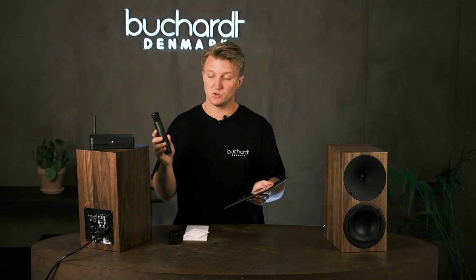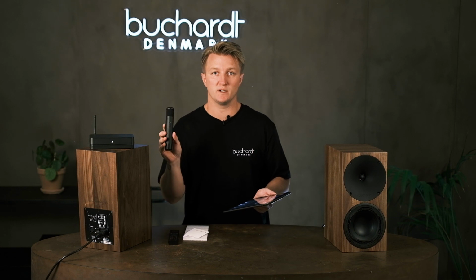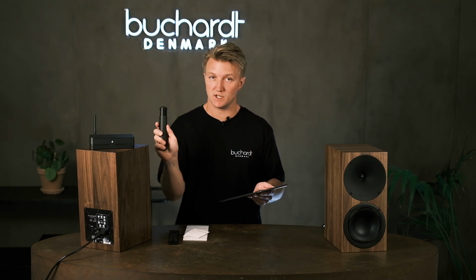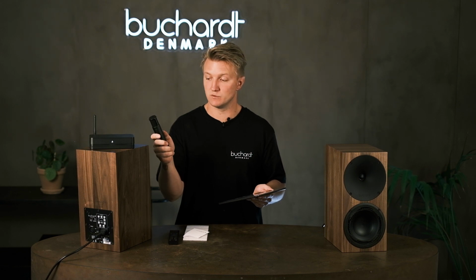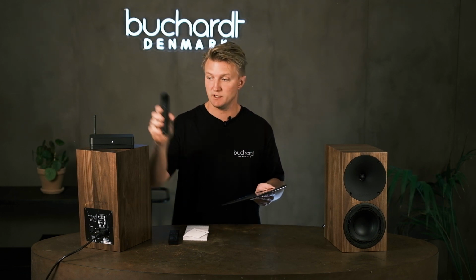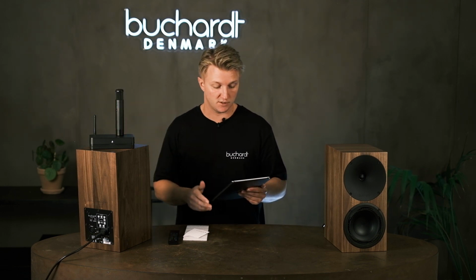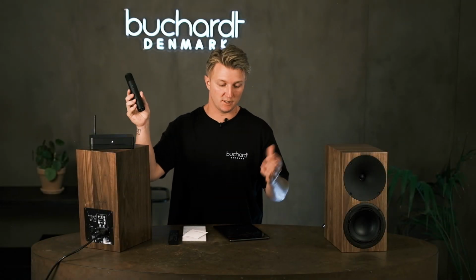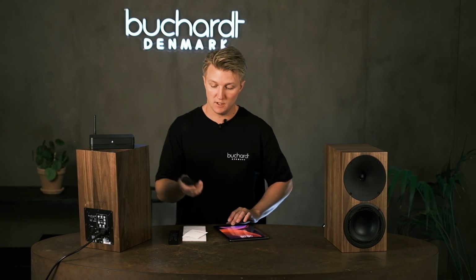So the first thing we need to do when we have connected it to the Wi-Fi is to perform an update. It's pretty easy. You just tap 4 times on the power button. 1, 2, 3, 4. And it will flash blue and green. And that means that it's now doing the update process. So let's just leave it there for a bit. Okay, now we see that it's back at solid green. The update process took a few minutes.